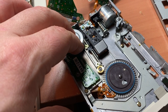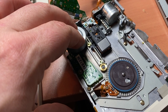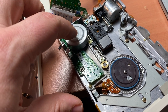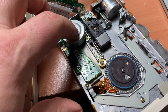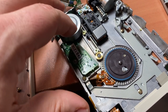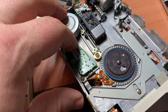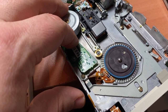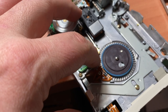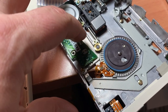This piece is basically the least accessible pulley. And so if it was already installed, it'd be the hardest one to get on, right? So we'll route it around there first, install with it routed, basically just put that belt on there, hold it with your finger as best you can, and then set this down. I would recommend getting those screws in, because that'll hold everything in place. Then go around the outer edge first, and then loop back here last, because that's the last point of tension.